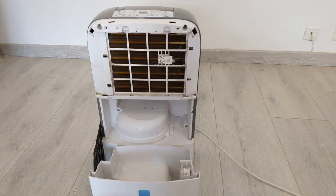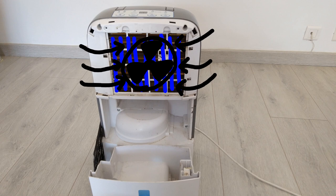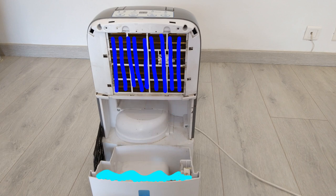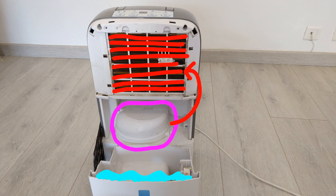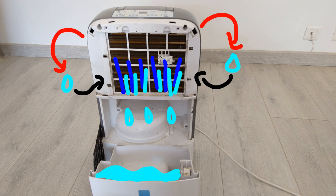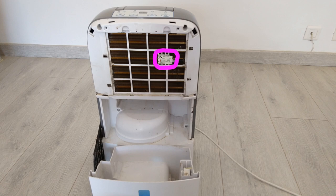Step zero: a quick introduction on how dehumidifiers work. Like in a fridge, a compressor creates a heat pump which cools a radiator. A fan sucks in air, forcing it through cold blades — since cold air can't hold as much humidity as ambient air, water condenses on the large metal surface and drips into the tank below. The less humid air is then warmed up again by the hot side of the heat pump, absorbing even more humidity, and the cycle repeats until the desired humidity level is reached. This whiteboard is actually a sensor measuring the humidity of the incoming airstream.